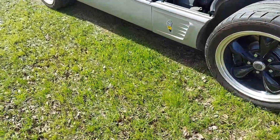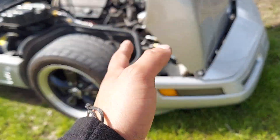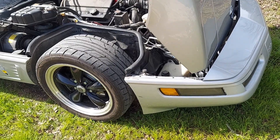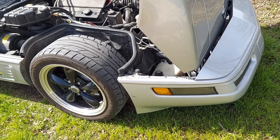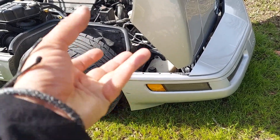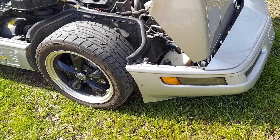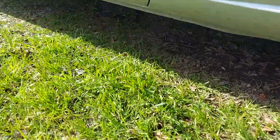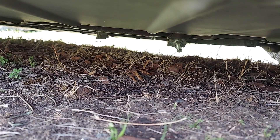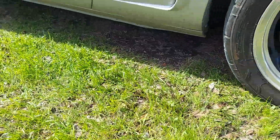Another thing — the front end aerodam, which is plastic and is meant to be replaced every however long it takes to wear down. Keep in mind that thing is already low — it's lower than the actual fender, and it sucks in the air, flows it inside. It was already like two inches from the ground, so now it's like an inch off the ground. And look at the exhaust right here — it's no more than two and a half inches off the ground. So any driveway, any back road, any bump — you're gonna scrape for sure.